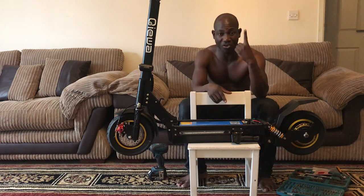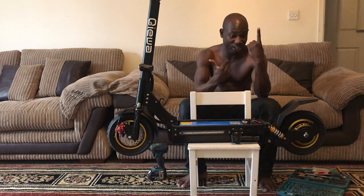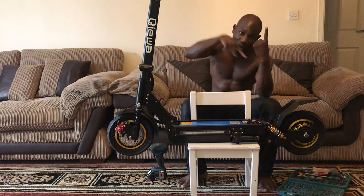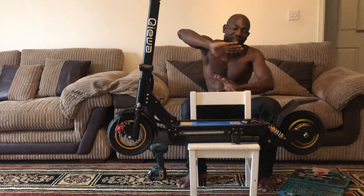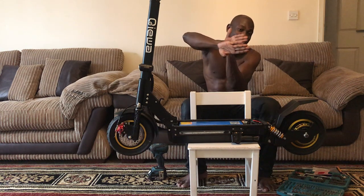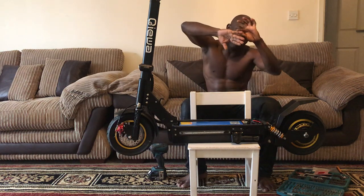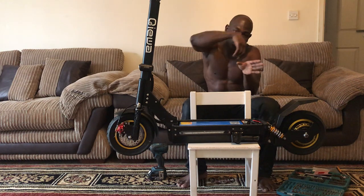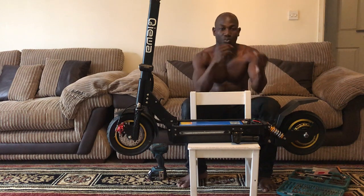The first step is mirroring. Mirroring is, when you look into the mirror, you see yourself back. So you're going to mirror the old controller and the new one. However the cables are on the old controller, try to mirror it with the new one. If you turn the old controller this way, turn the new controller that way, so they're in the same direction. Whatever this one is saying, it should be the same on that. That way, you take one cable from here, you put it to that one. You take another cable from here, you put it to that one. So you do mirroring. And then after the mirroring, you do one-to-one.